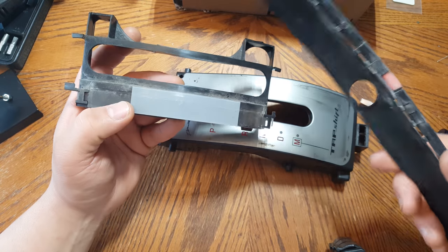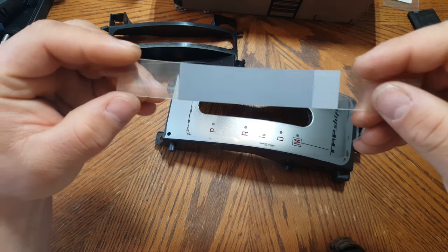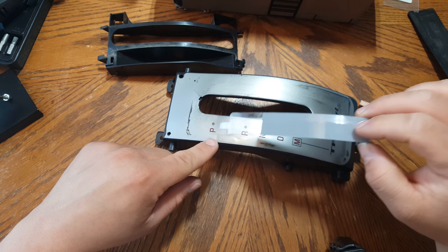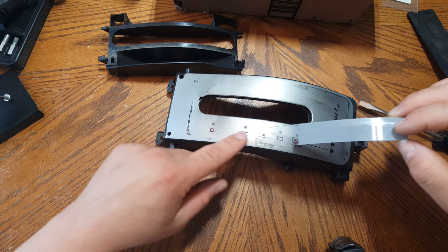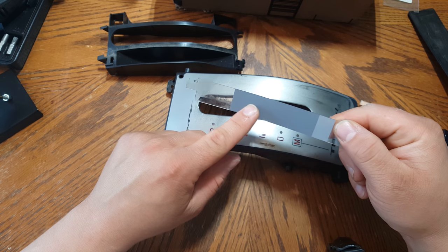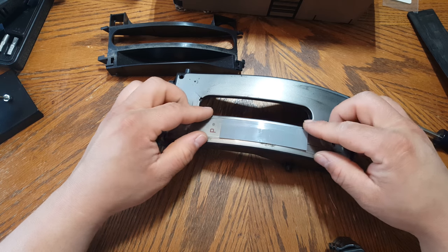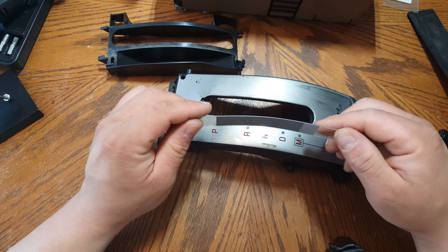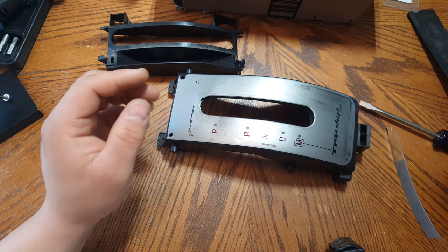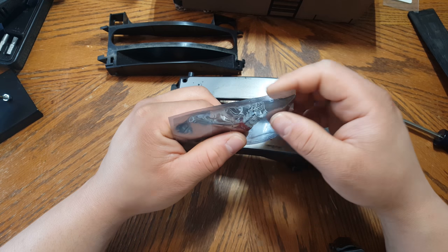You can slide that away. What you have here is a plastic piece that diffuses the light — it actually blocks light, but you can see how it gets lighter and lighter as it goes outward. The incandescent bulb sits right underneath here, and to keep bright spots from showing through they put this piece here so the strongest light is blocked the most, while park and manual at the far end see the most light — dispersing it equally throughout the entire housing. We're going to be getting rid of this because this LED here is a really good size with a wide angle.